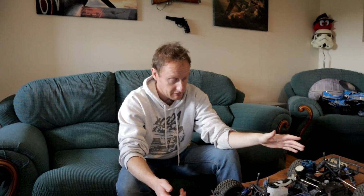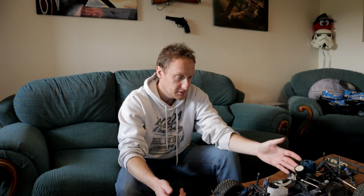Okay, it wasn't running right, as I said. It wouldn't idle and it wouldn't start. I leaned off the high speed needle, and it was good. It went well, but still wouldn't idle. Alan recommended I leave the low speed alone. It should be okay, but from what I read online, maybe the low speed was to blame for it not idling. So I dialed it back, leaned it off, and now it can sit and idle happily, and it'll start.